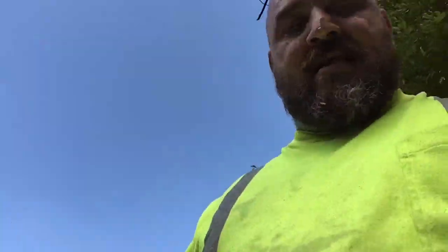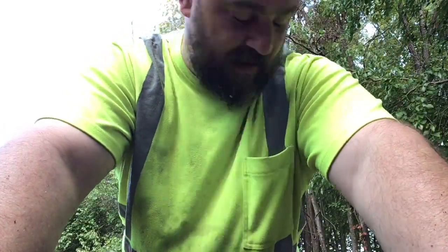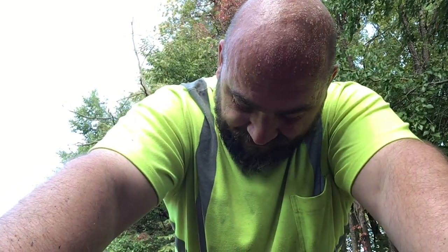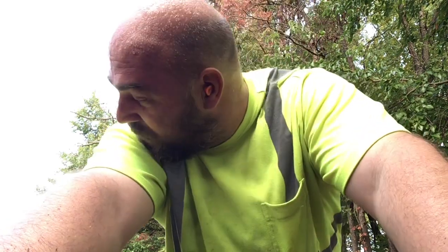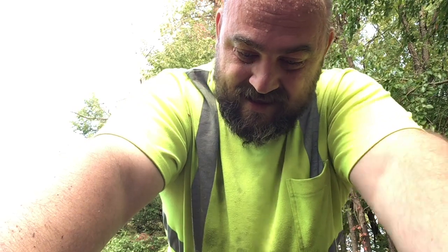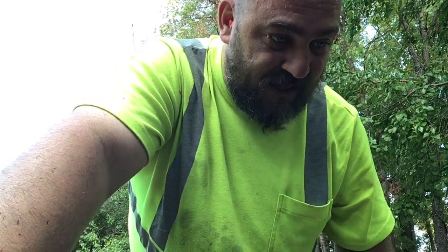The rakers aren't deep enough. Not even close. It's funny how much the tuning changed. I had to go richer on the low. Like a decent amount, almost probably a quarter turn, maybe a little more. It was just too lean.